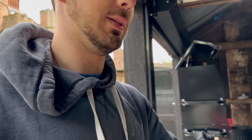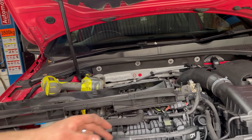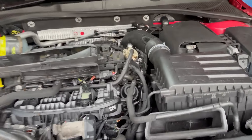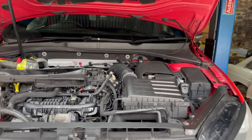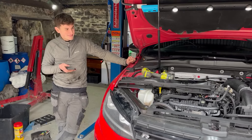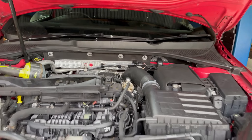We're almost done. We've got intake back on, throttle body back on, new water pump, new thermostat. And we're just going to see if we can do the fake R600 mod — where you just drill out this to get a bit more air intake into the car. This sits on here and the blank bit's here, so it just allows a bit more airflow in there. You can get a bit of rainwater and things like that, but it's unlikely. Tom only drives this when it's a driveway princess car. We'll get it all back together, give it a start up, bleed the coolant, and then we'll get straight on to the centre res.